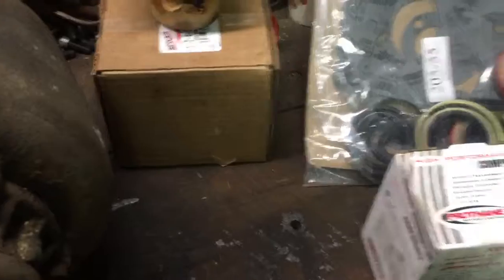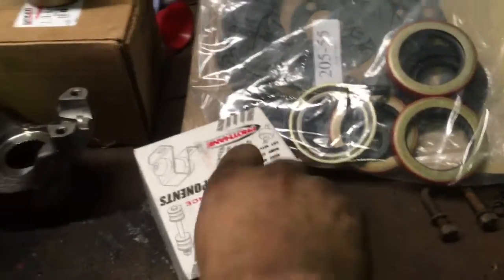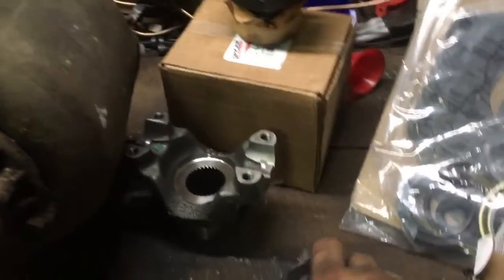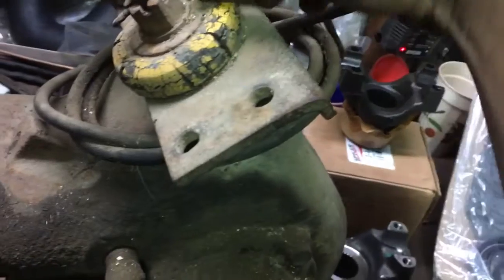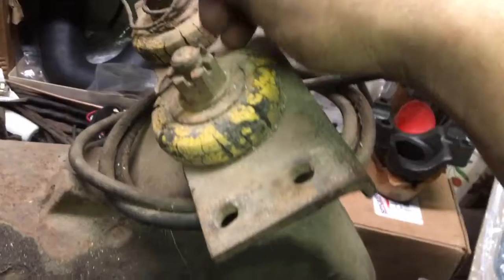This is another 1410 yoke, by the way. Right here, we have wonderful mounting bushings, because these things, well, those are kind of dry rotted. Plus everything else is poly on this truck, so we're gonna go with some poly mounting bushings. Bottom piece, top piece, that's all there is. Works with the factory hardware as shown. You replace these Ford ordeals, which I'm not even sure why Ford does these. I'm gonna replace them with actual cotter pins.